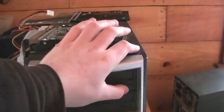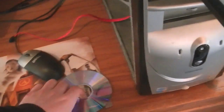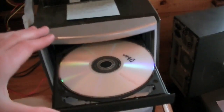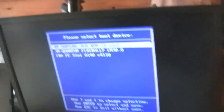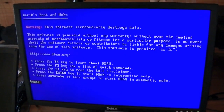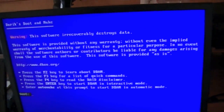Now go ahead and set up your computer. You have to go to your boot menu. Some computers are set to automatically boot from discs, some are not — it depends on your BIOS settings. Going manually to the boot menu is usually the best option. Select to boot from the DVD-ROM drive if that's where the disc is, or select to boot from the USB device if you're using a flash drive.